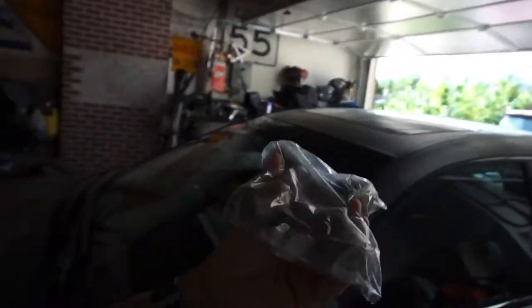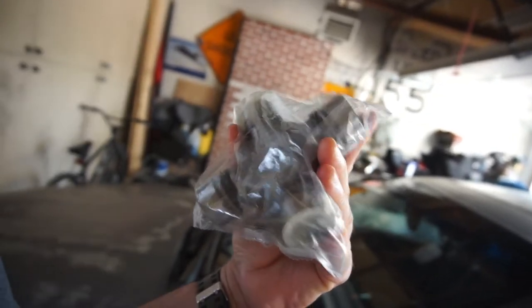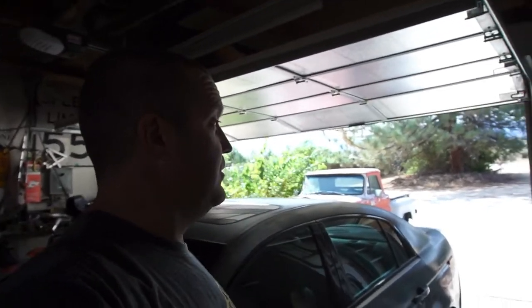Okay. Next. Ordered this big old U-joint for the 4th gen. For one side, when I did the bearings, I did all the front axle bearings, and one of the U-joints had some play in it, so I replaced the U-joint. And the next part I'll show you. Taking the axles out, so while I'm in there, I might as well just replace the other U-joint. So here we go. On to the big reveal. You know what? I'll save that for last.